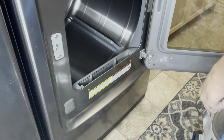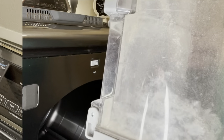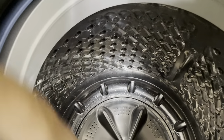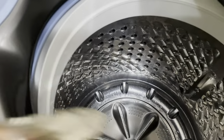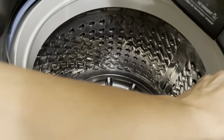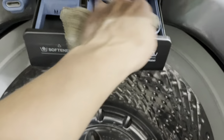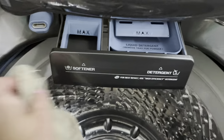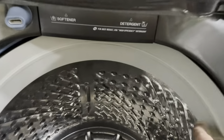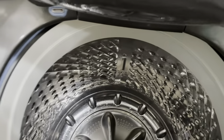It works like a charm every time. I'll make sure to leave the product information down below. Now back to the washer — by the time I've run both cycles, one with vinegar and one with bleach, I usually have everything cleaned out. Occasionally I'll still have a little bit of dirt or buildup on the white rim, and for that I just wipe it down with an all-purpose cleaner and then take a magic eraser and gently go around the rim. Then I leave it open to dry and it's complete.